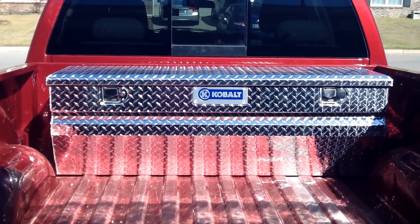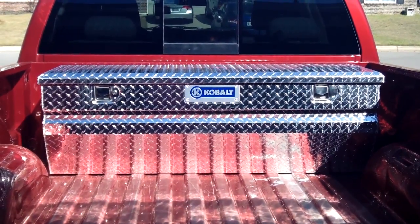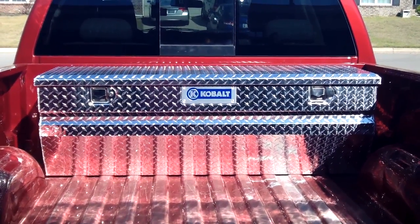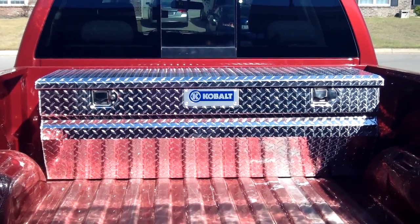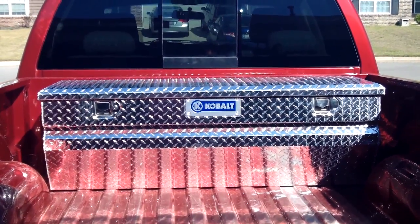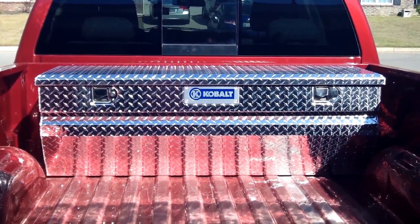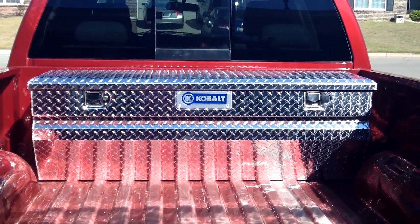So most of the time you're supposed to attach these using quarter inch self-tapping metal screws, and it usually comes with those. Mine didn't, like I said, it was missing stuff, scratch and dent and everything, so discount on it. So I had to get my own hardware, and I decided to upgrade to substantially thicker 3/8 inch bolts and lock washers and washers and stuff like that.